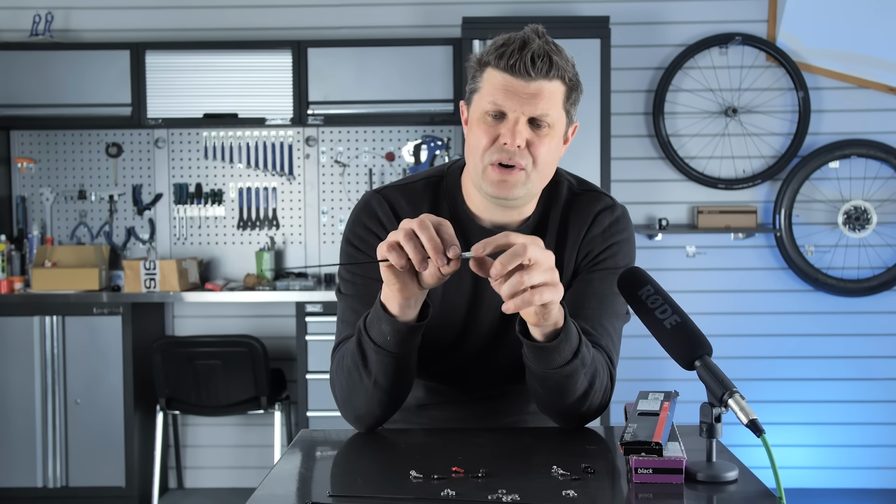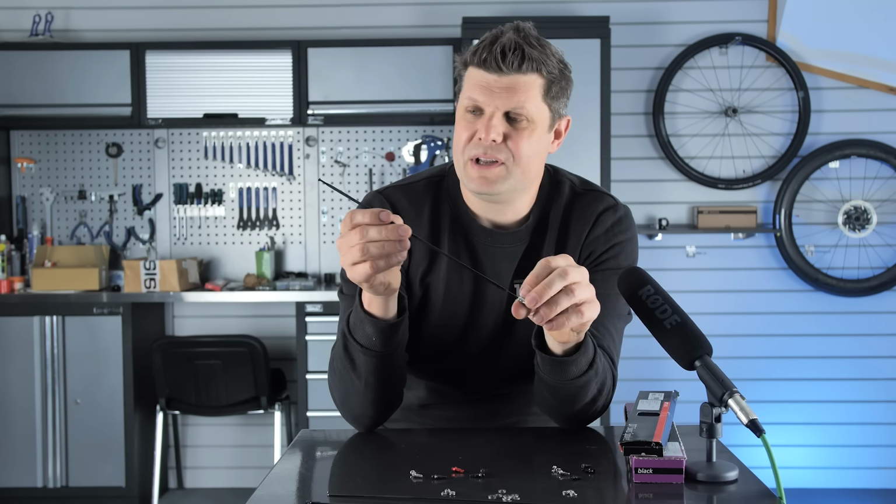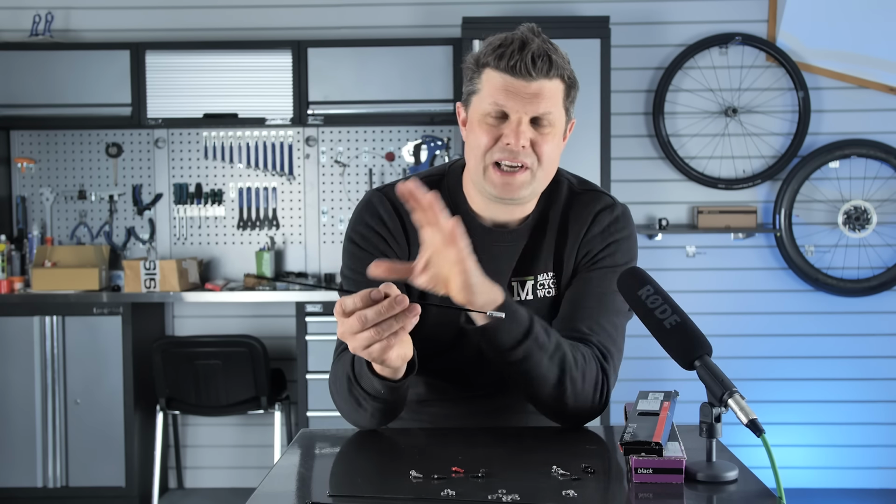And these can corrode, and if you haven't got exactly the right tool, these often get chewed up by people, and you know, they're fantastic out of the box, but durability down the line, these can be a bit of a pain. However, Mavic are fantastic at providing spares. So unlike a lot of wheel brands like having pillar spokes, you can normally go into any bike shop and they'll be pretty confident that they can get hold of a Mavic spoke.